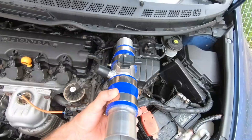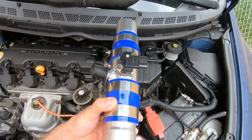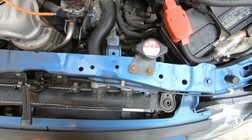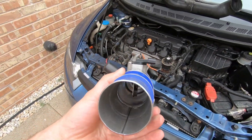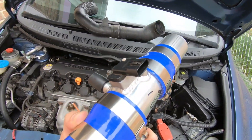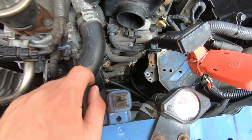The good thing is I've got the intercooler mounted up over here and my mass airflow sensor is going to be in the charge pipe. That's my charge pipe setup right over here — my mass airflow sensor is going to be reading air temperatures that have already been cooled by the intercooler. So hopefully even though I'm sucking in warmer air, it cools down a bit by the time the sensor reads it.